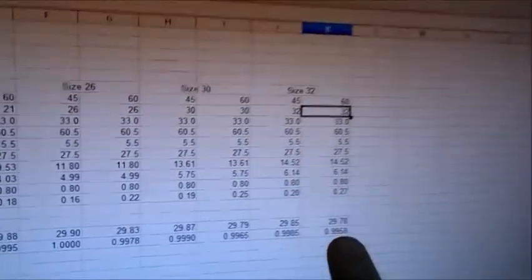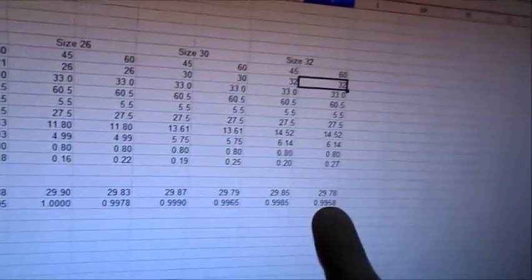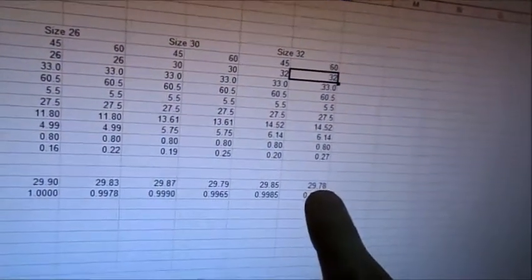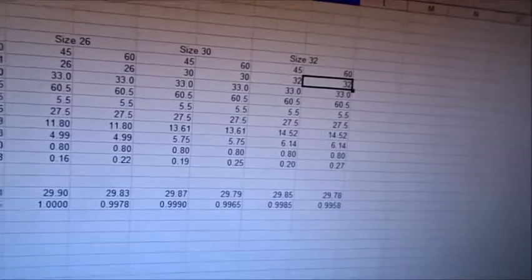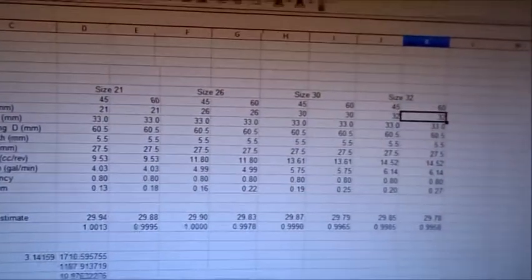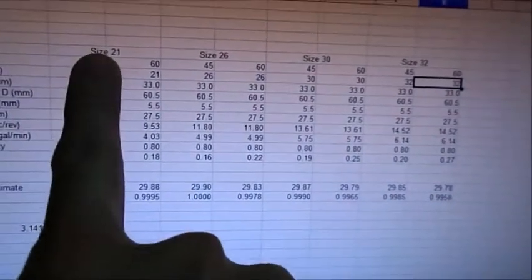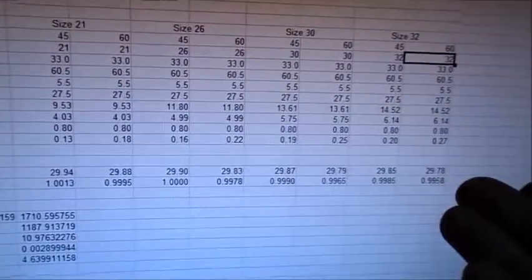All right, so if you put one of these monster pumps in here, the monster pump is going to take a little bit more energy away from you. So let's go to the big pump with the biggest pressure. And we've dropped less than 0.5%, which equates to about 0.12 miles per gallon. Sorry, so that's not very much change. Which means, once again, we have a component that, try as we might to drop the power and get a little bit more mileage, it doesn't really make all that much difference.